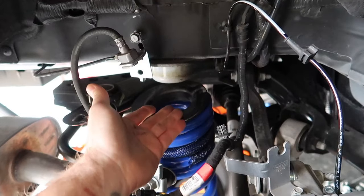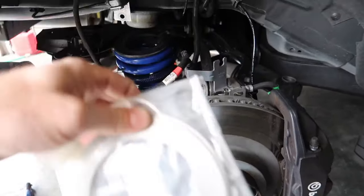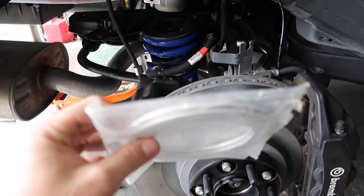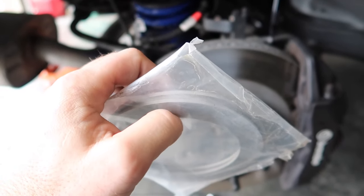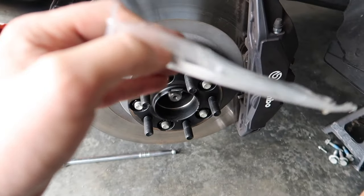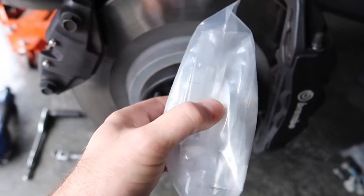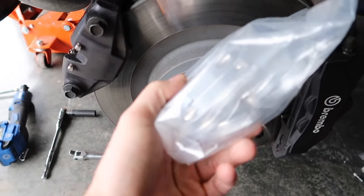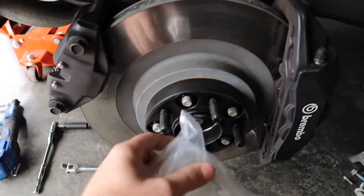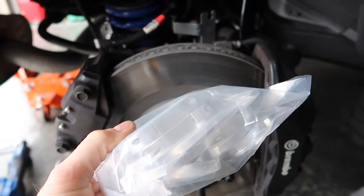It's not going to increase noise, vibration, or harshness because you still have the rubber isolator sandwiched in there. Because of the geometry of the rear suspension when settled back down to the ground, the thickness of this is basically going to double when we load the car - it's actually going to raise the back of the car about a quarter of an inch, which is exactly what we need to have this thing sit even with the front. And the bushing lockout kit should get rid of about 90% of wheel hop. If you want to do the long arms and sway bars, definitely recommend those too.